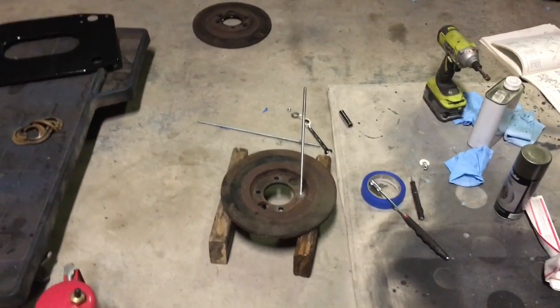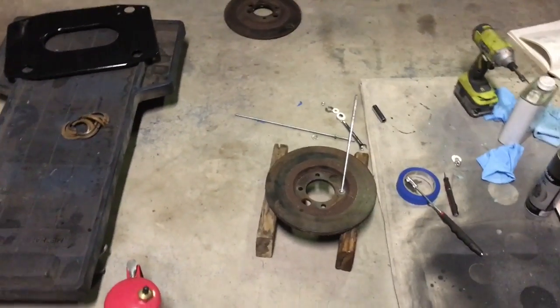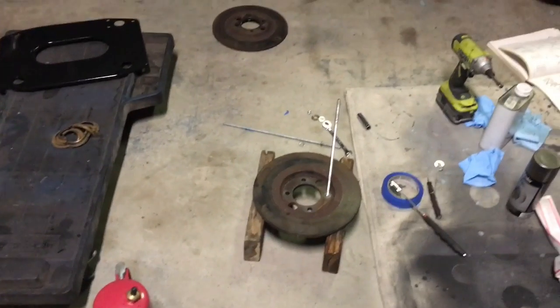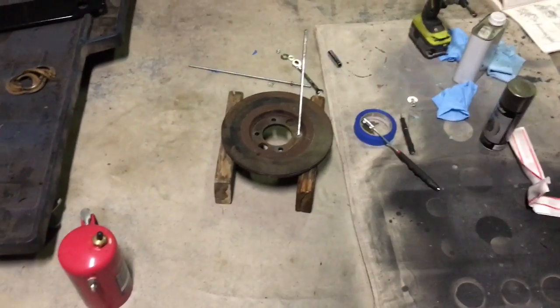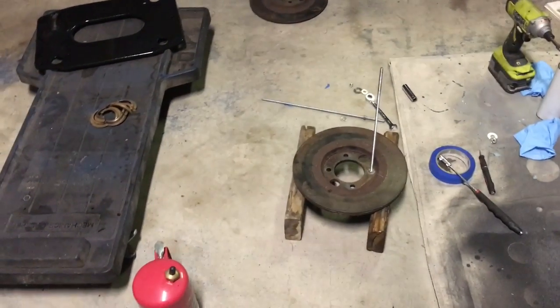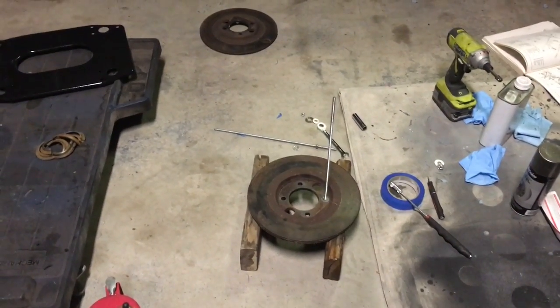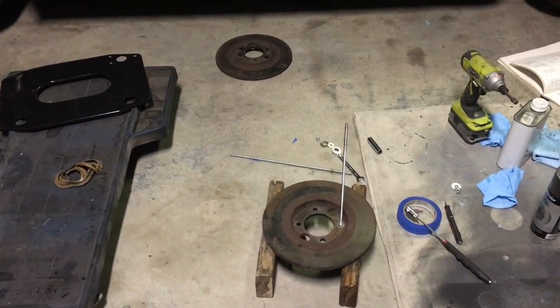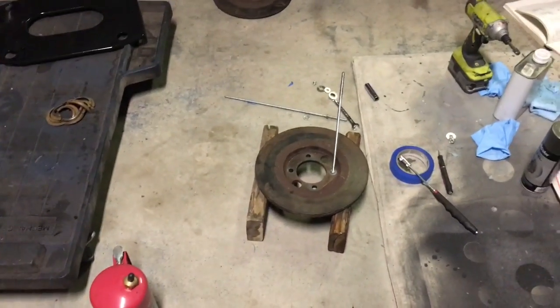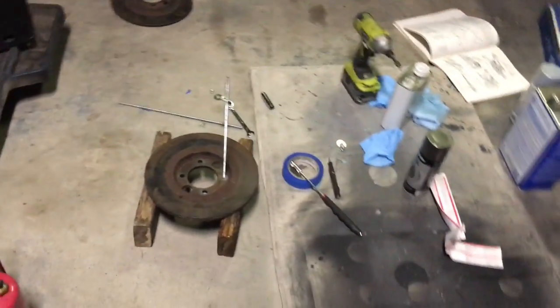One of my rods, the nut that I was using to drive up and down, ended up binding up to the rod, so it's kind of shot. So if anybody sees this in the future and wants to do it, I wouldn't use 1/4 inch. I'd go up to 5/16 or 3/8, because I think it'll be stronger. I think the 1/4 inch was borderline. Well, you want to run out of gas as you cross the finish line, and it ran out of gas as we crossed the finish line. So I think that's a win.